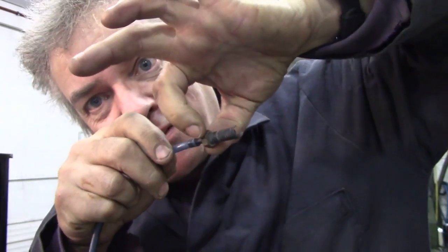And then all you have to do, with your fingers, you can actually put the nut back on and just nip it up a bit. It doesn't need to be super tight, just give it a little nip. It doesn't need to be monster tight. And try to avoid turning the jet itself, because this piece is glued onto the vertical bit, and that's the bit that drops off. So just be careful. You can just hold it and tweak it just a little bit, but it can be done. It's better with a friend. A lot of things are.